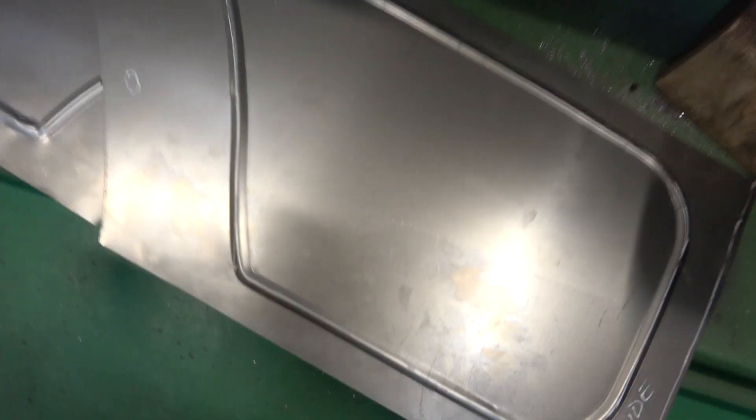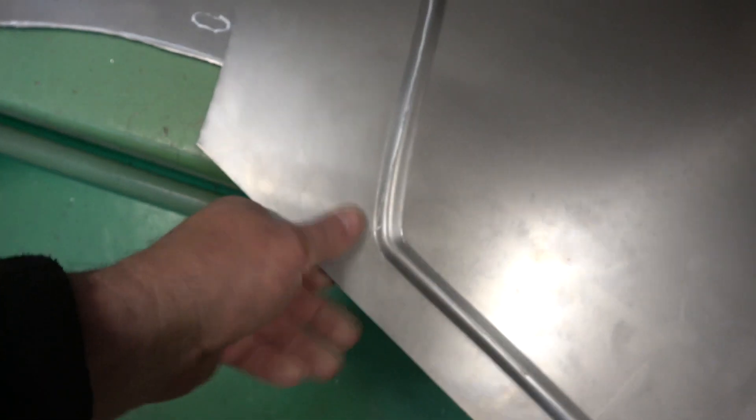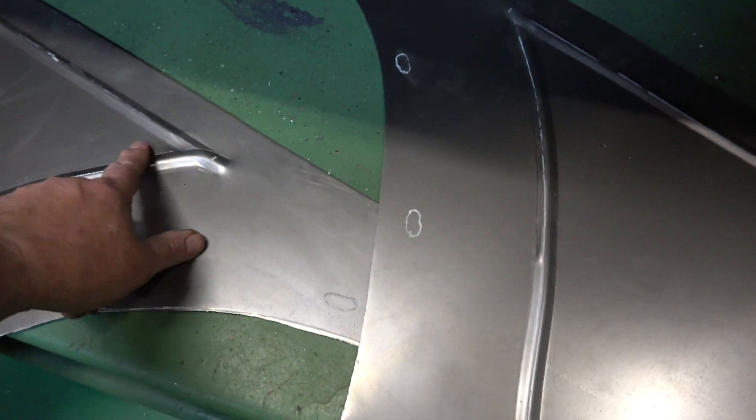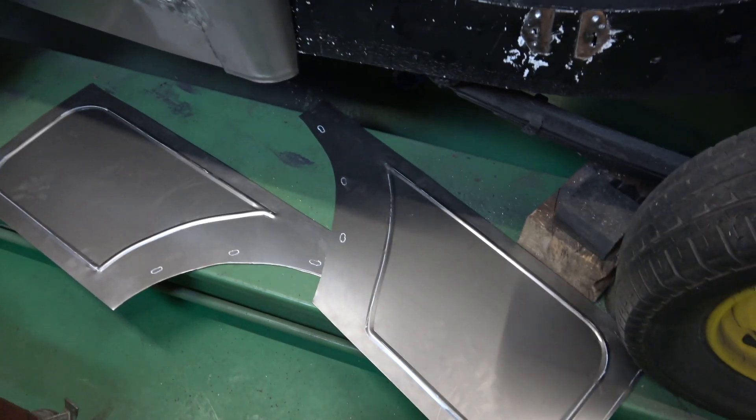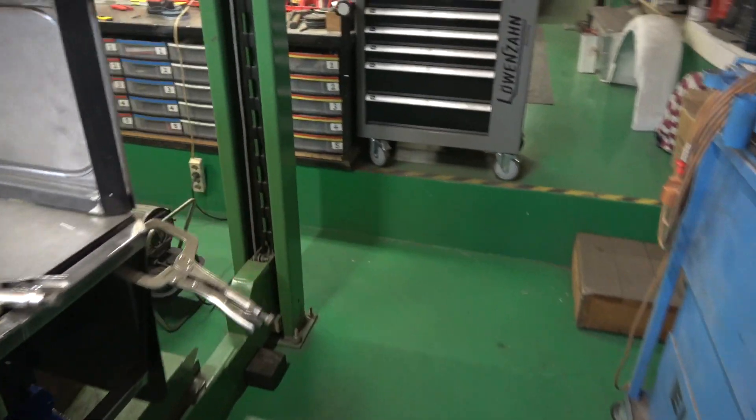These are the two panels we made for the other side — we need to doctor them up a little bit. There are a few bits here where we've had to double over it, and we can make them better with lead or a hammer and dolly. So that's good. We've got it all done before he goes. I think that looks really nice.